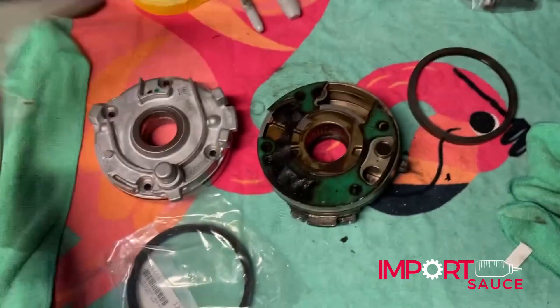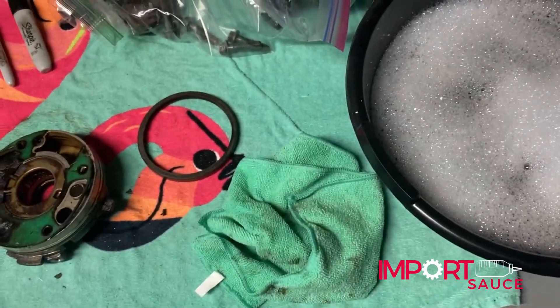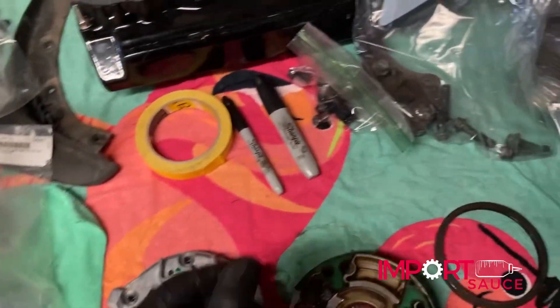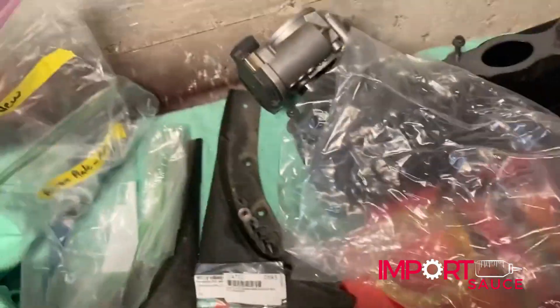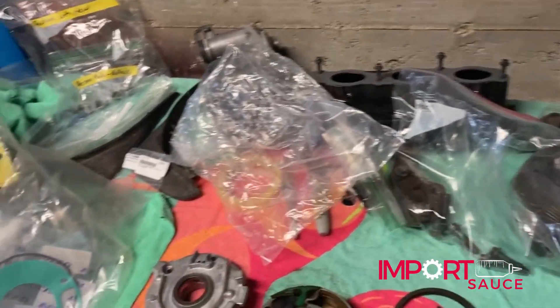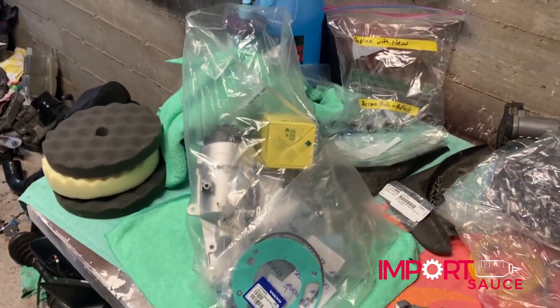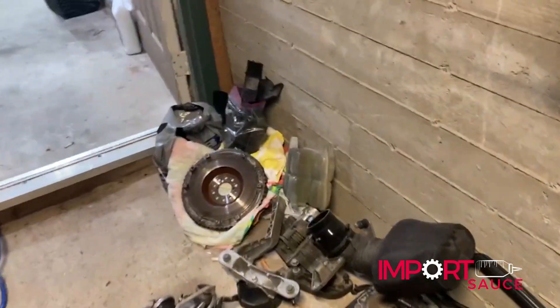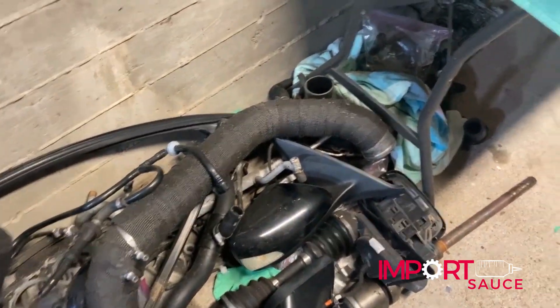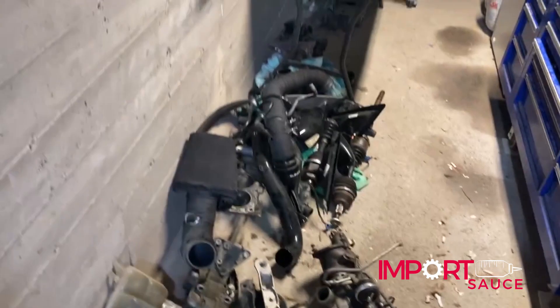We compare one by one. The four bolts that hold this go into our hot tank — they soak, then we pull them out, we toothbrush them, we degrease them, and then we run our thumbnail through each thread of each bolt. And when we're done, we tag it, put it all together, and stick it in our done pile downstairs. So we're going to continue to move through all of this stuff, and that will get us ready to bolt everything back on — brackets, things of that nature, hard tubes — we're throwing them under the table. We already have a pile that will get scuffed, primered, sanded, painted, cleared, as part of cleaning all this stuff up and getting it ready to go back on.